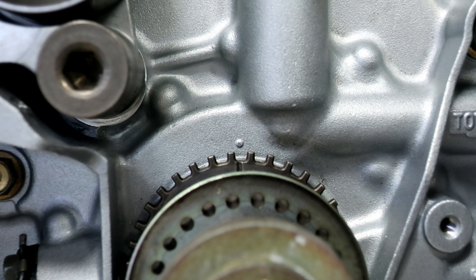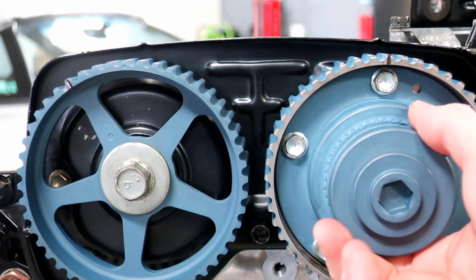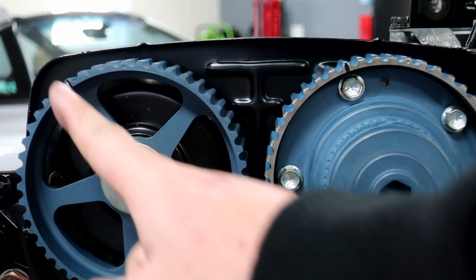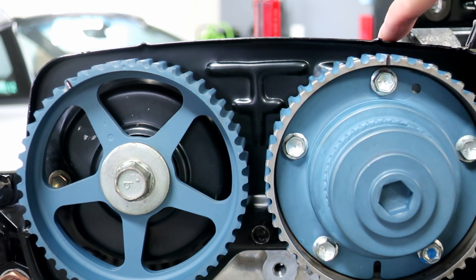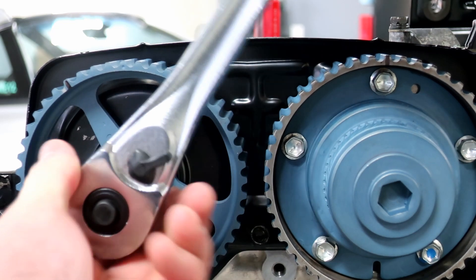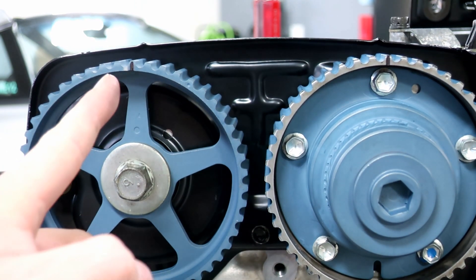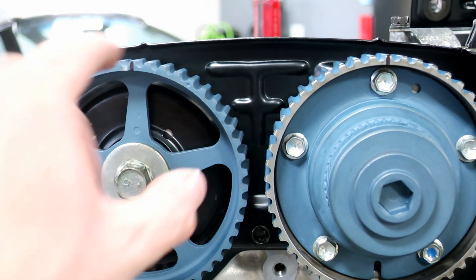Now we need to move up to the cam gears and line them up with the backing plate. You'll see little black marks at the top — a little mark here and a little mark here. This is your backing plate that helps you line up for timing. Now the VVTI gear can move back and forth. There's a little dot on both cam gears — do not base it off the dot. There's a little line that goes through the cam gear on both of them. I've marked it in black here to make it more obvious — that's what you're going to line up with. My VVTI gear is already lined up perfectly with the tick mark on the backing plate, but my other gear is not. I need to move it. You'll notice it's not perfectly perpendicular — it's slightly to the right. From the book, it tells you it needs to be slightly to the right when you're standing in front of the motor. That's how the book shows it, so don't be worried.